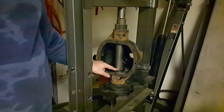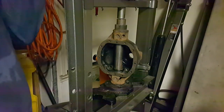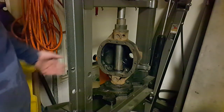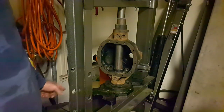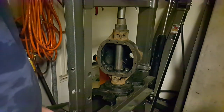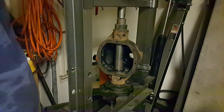I have in here a die — it's actually a transmission press tool — but I'm sure you can find a die that's just under 2-1/2 inches. This one just happens to fit in perfectly. Under here I have my pipe flange which I've machined out to 2-1/2 inches. I've never done this and I have no idea if it's going to work. If it cracks the housing, this project is a wash. So now we're going to see what happens.